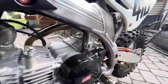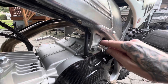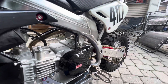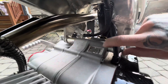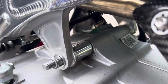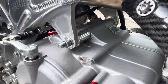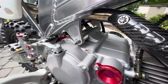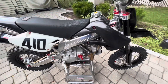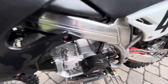Something that a lot of people do, and something I recommend, is if you're going to run the heavier Daytona motor in these MM12P frames, have the motor mounts reinforced. Duane over at BBR can take care of it for you. The frame has to be reheat treated, so it's quite a process — you're going to have to take it all down and send it out. I shimmed out the motor mount so that when you tighten down this bolt it's not squeezing or pinching — that's usually what causes them to crack, right along here. That's the benefit to having the frame reinforced and reheat treated. I've been lucky so I might send it out this winter to have that done.